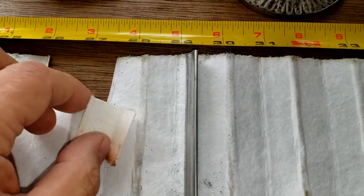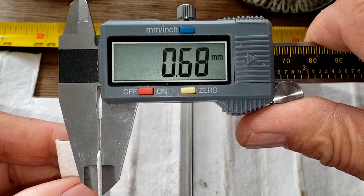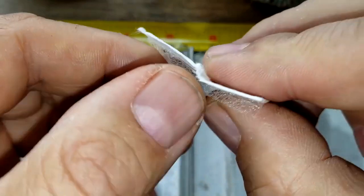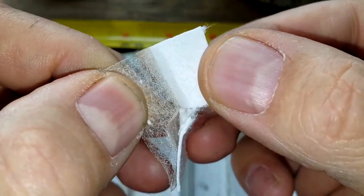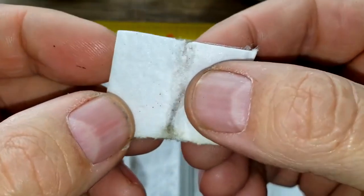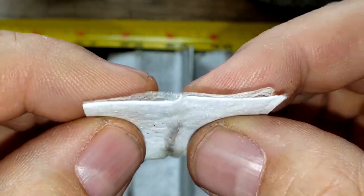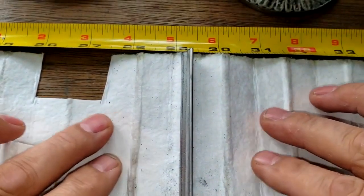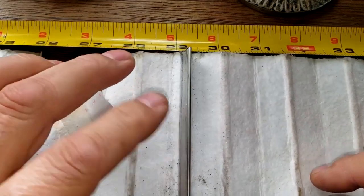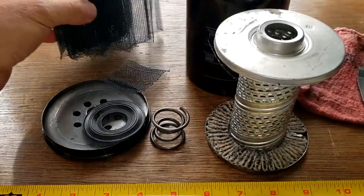Here she is at the seam. I got a little sample for measurement — 0.68 millimeters, which is a little less than the average of about 0.8. This stuff is soft — you can see the backing on here, and it tears really easily because it's just synthetic fibers. It's nice and soft filter media, and by itself it would probably tear. But it held up really nicely after cutting it.